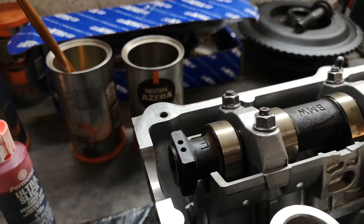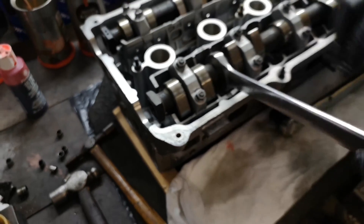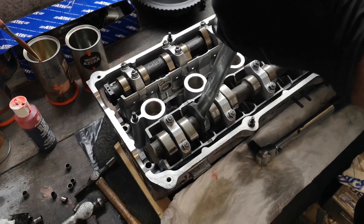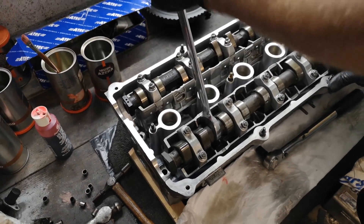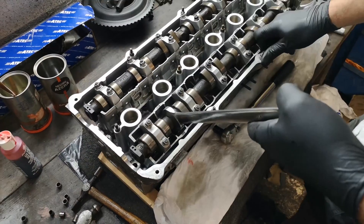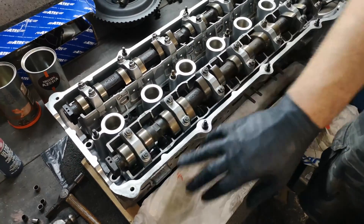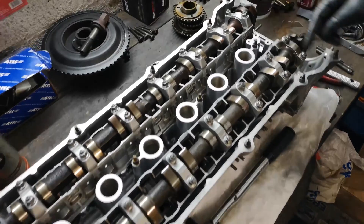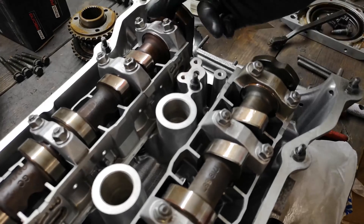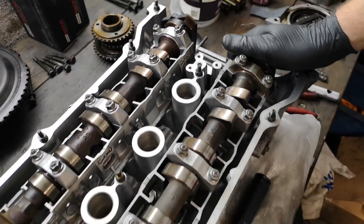We've got standard timing marks on the M54 cam - you can see the two dots on the camshaft, which is pretty much at top dead centre. If I rotate this cam around - this is a big crunch point - will it turn? Yes, it will turn. This cam, if it were sitting as an intake cam, would sit something like that. You can see the marks are pointing upwards. Anybody who's worked with these engines will know that at top dead centre the lobes should point upwards and towards one another roughly.